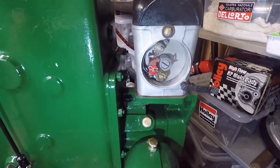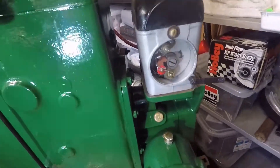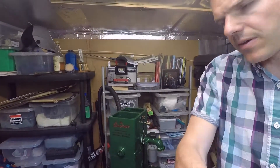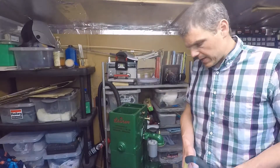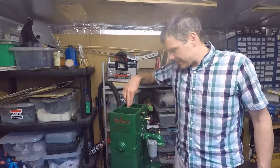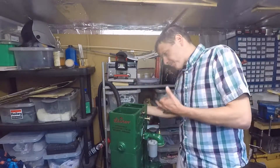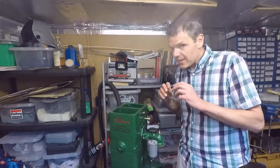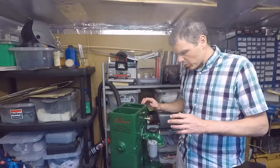So I am about 6.6mm away from this timing mark, which means the timing is okay as it is. I might be one or two degrees off, but not far out. I also used the hand crank to check the timing — going through the revolutions to confirm I'm getting inlet, exhaust, and then the spark. I didn't crank heavily because the engine hasn't got any oil, so I was careful not to go crazy on rotations.